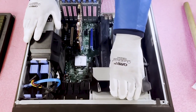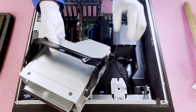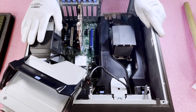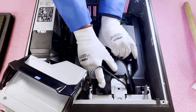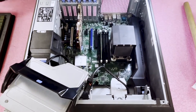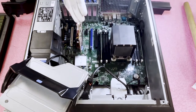To get started, lift this latch up right here and it slides out — there are two notches you lift and pull up. You can disconnect all the cables if you want; I personally just set it to the side and am extremely careful. You'll notice there are two air baffles or air shrouds. They're interchangeable — you don't have to lift one before the other. Simply pop the tab and lift up. Be careful of the cable. There's a little plastic notch that goes into a hole — that's how you'll put it back. Once both air shrouds are out, you're fully accessible to get to the RAM.